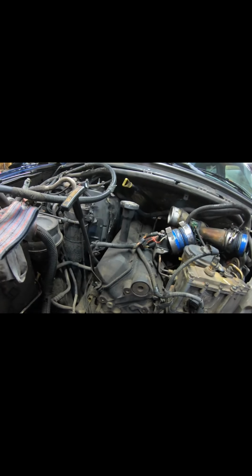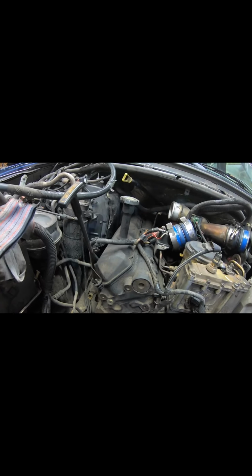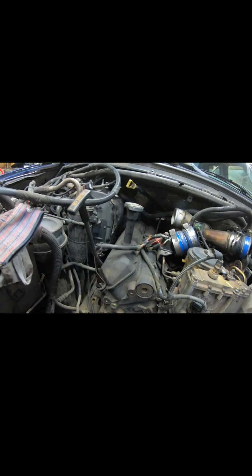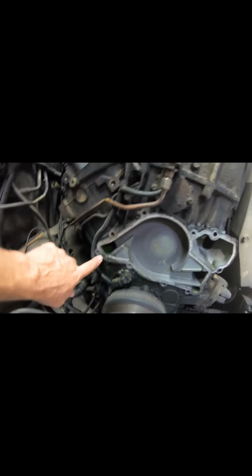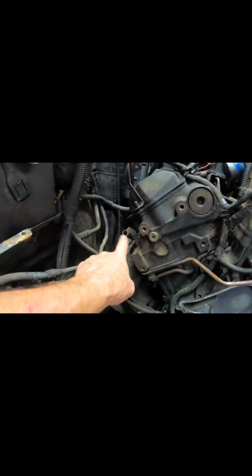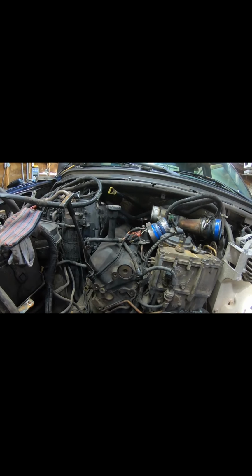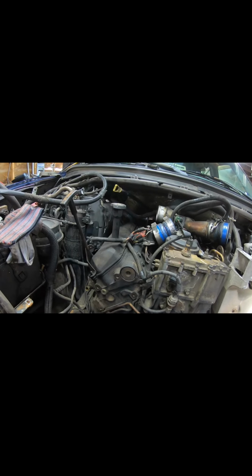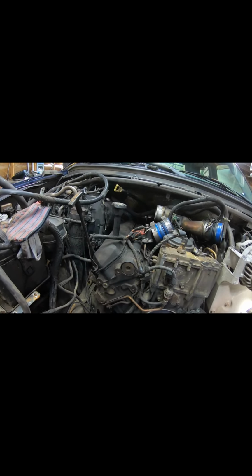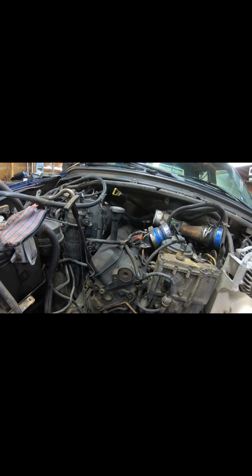Pulled all the glow plugs out, and I applied pressure to each glow plug hole, each cylinder. When I did it to number 7, I can hear air moving inside. Doesn't sound like it's coming out any of these coolant ports, not even the one here for the heater hose return. I don't hear any air coming out of here, but it is going into the interior of the engine somewhere. So it sounds like a head gasket or a cracked block or cracked head or something.